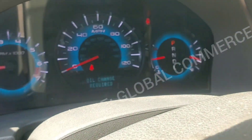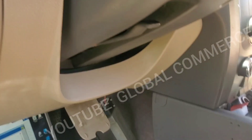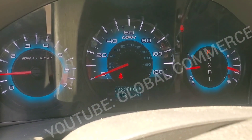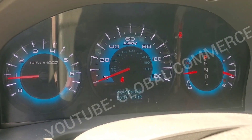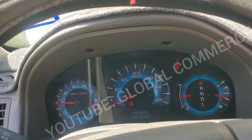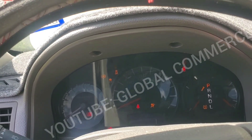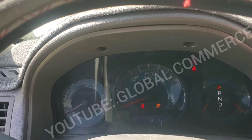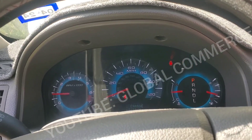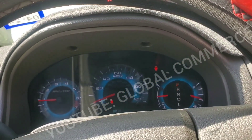Correction guys — you do not have to do the parameter reset. I forgot to turn off the 18-volt supply, which is necessary because it will keep the ECU in programming mode — that's why the security light was on. Turned it off and we're good to go. So there it is, all good boys. Like and subscribe, see you on the next one. If you didn't know how to do this, now you know — and knowing is half the battle. Happy days, thank you.